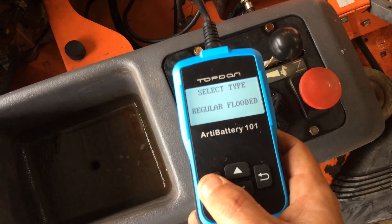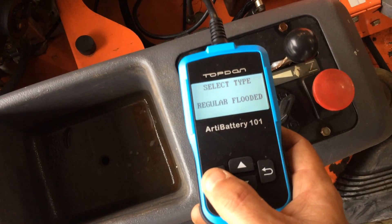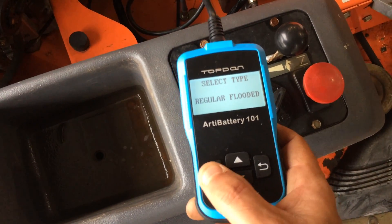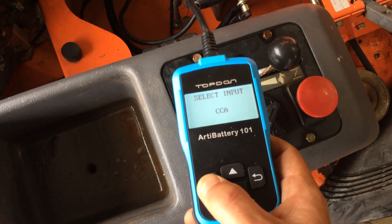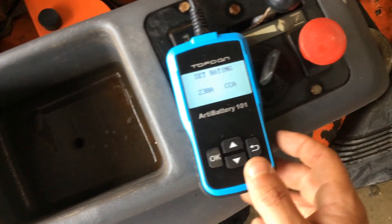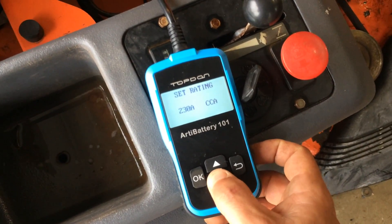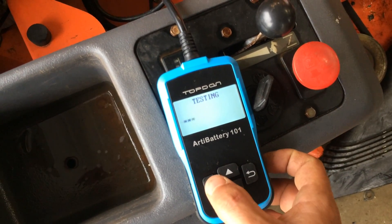Although it did just mow with this tractor. Select the type — it's a flooded battery — and select the cold cranking amps. If you look on the battery right here, it says this one's 230, so it's already set. You can go up or down as needed.